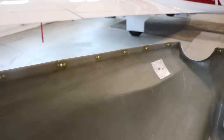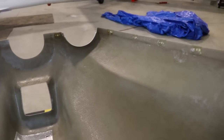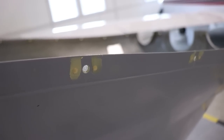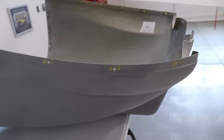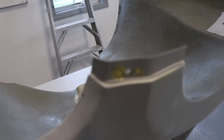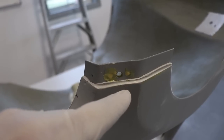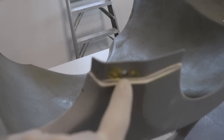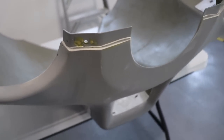So here it is — all of the holes are now filled. On the outside I've tried to wipe away as much of the peanut butter resin as I can to save a little bit of sanding. Each one is now filled; once it dries I can sand it smooth and this whole area will be as smooth as the rest, with the exception of the one big hole. Then I can put a nut plate behind there and drill two new holes for the new nut plates.